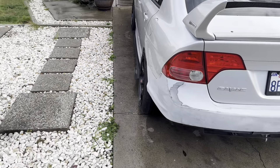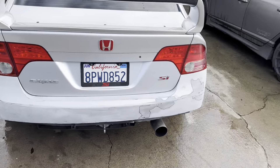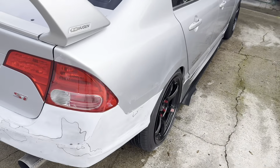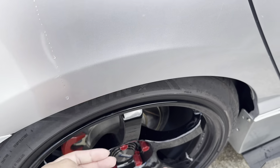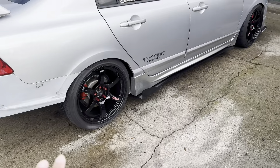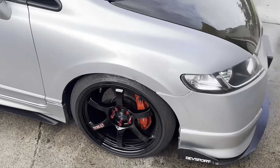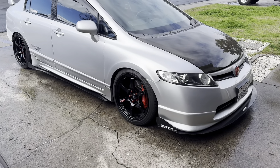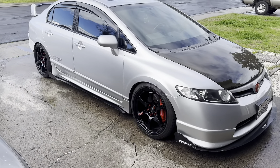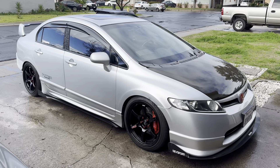On the back, I do have slightly more camber than I would like — my guess is that I'm at like two and a half to three degrees in the back, which is a little much for my taste. But if I really wanted to reduce the camber, I could still stick my fingers in between the tire and fender, and I could also shave the fender a little bit on the rears for more space. I think it's fine — I don't drive this car that much anymore so I'm not worried about the camber wear on the tires. Overall, I am super happy with these. The only thing I'm missing are red valve stem caps, but I'll pick those up eventually — they're not that expensive and I think they'll really set the wheel setup off even more. I'm super excited to have these wheels on the car — one of my dream wheels and I think they fit the car perfectly.